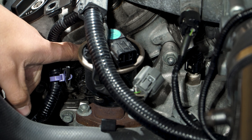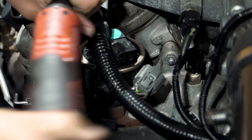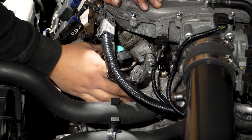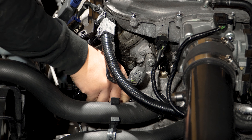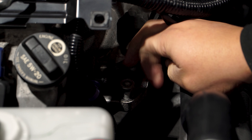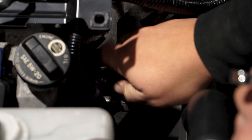I'm kind of scared to do this because I'm about to expose my valve cover leak. Here we got two 12 millimeter little nuts on there. Take the EGR valve out. There's the OEM one. Make sure you guys take off the gasket. You can see my valve cover leak right there. The new kit comes with the plate, new gasket, and a new set of Allen bolts. Put the nut on backwards and do the old twist-a-roo. A little tight in there but it's coming out.